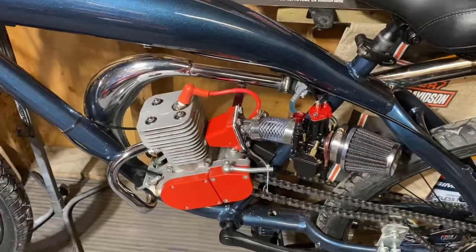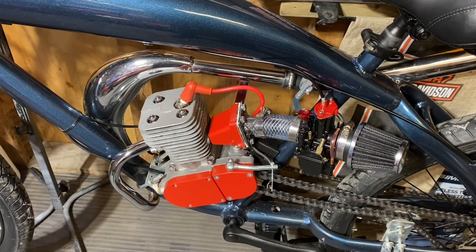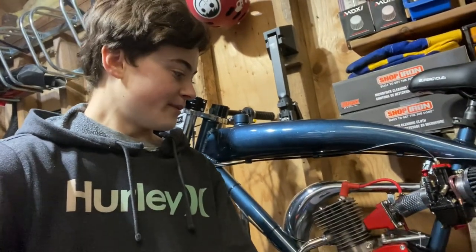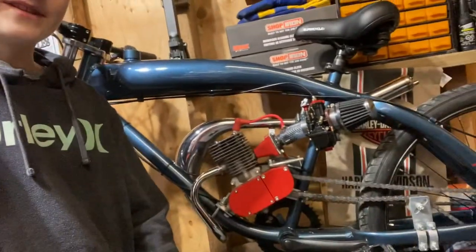That's all I have for you today — if you enjoyed the video make sure to give me a like, and if you have any questions or concerns comment that down below. Stick around because in the next video we're actually going to be taking this bike out for a nice long ride. I'm still in break-in so I won't hit full throttle too much, but once broken in I'm going to go from a 20:1 gas mix to a 32:1 with full synthetic oil — on the YD100s they really like that full synthetic oil.